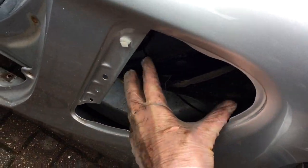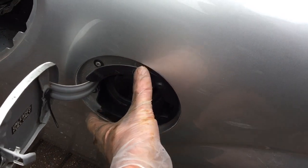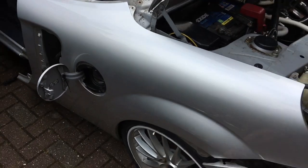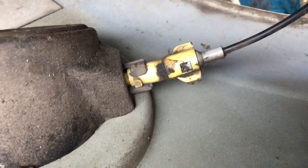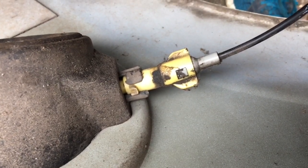There's no need to remove the plastic intake skirting here, but I did it anyway. As for the petrol tank lining, I've unscrewed it but I'm not sure that's necessary. Under the panel there is the tank flap release mechanism, which just unclips by hand — you rotate it counterclockwise and it slips out, no trouble at all.